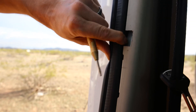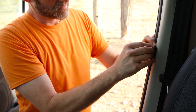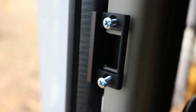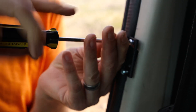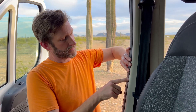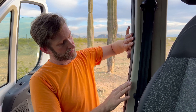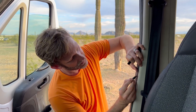There's a little spot there for the deadbolt. Next we install the trim piece that came with the lock set — it's so it looks nice and frames the cutout, since cut plastic looks sharp and messy. However, the trim piece caused the door not to close, so we're not using it. We also need to cut some of this rubber seal because it's blocking the passage for the deadbolt. After cutting the hole in the plastic, the rubber still needs to be trimmed — I'll mark it with a little sharpie.